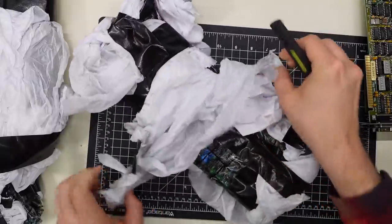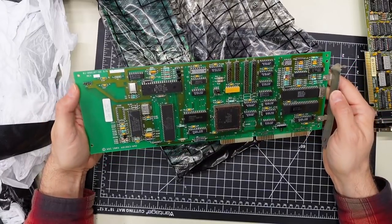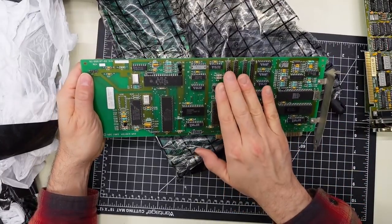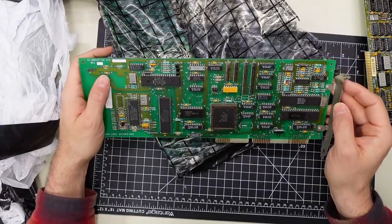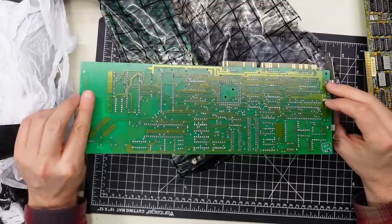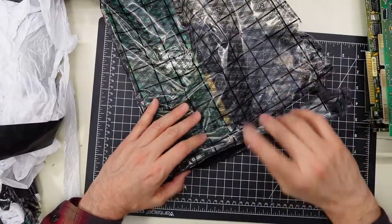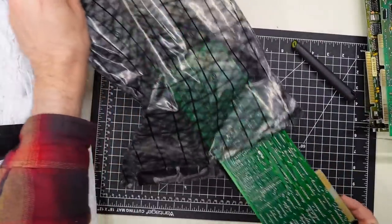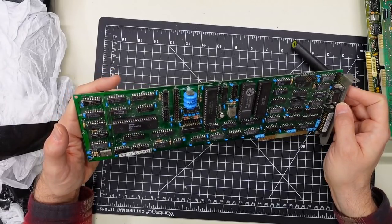On to the next bundle of cards — got the gaffer tape on here, I have to cut through. All right, we have a Western Digital MFM hard drive controller. This is for a 286 — it's the Western Digital 1003-WA2, a combination floppy controller with two hard drive support as well. This will be capable of supporting high-density disk drives. It's got a little bit of a bent bracket but nothing too serious. Cards like this are really useful if you're trying to use an old MFM hard drive or recover data. Keep in mind the hard drive controller matters — if you switch between controllers you may have to reformat.